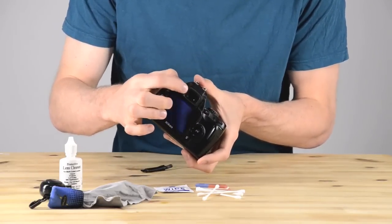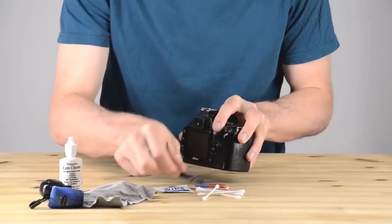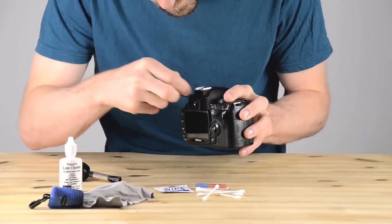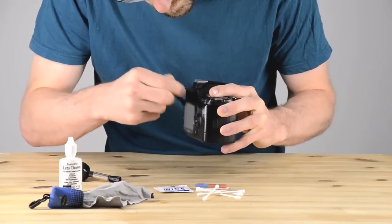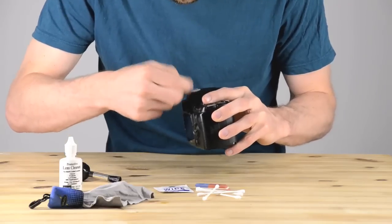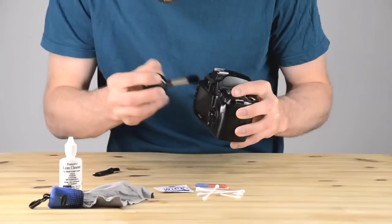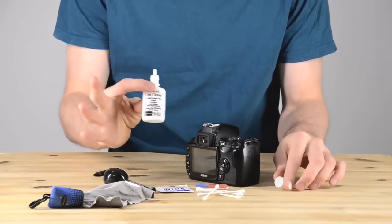Wipe that off, and now we're going to go for the viewfinder, which on all my cameras at least gets really dirty. It's important to switch brushes here — the soft brush is mostly for glass, for cleaning off the glass. I don't want to use the hard bristle brush on the glass because it'll scratch it, but the other brush has softer bristles. I then go around again with the hard bristle brush because there's more stuck-on dirt around that viewfinder. The hard bristle brush isn't as good at wiping dust away as the soft one, so I'll use the hard one to get the real stuck-on dirt off and then come along with the soft one to wipe it away.